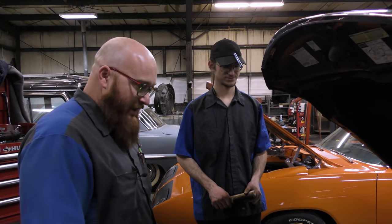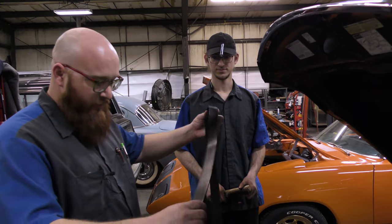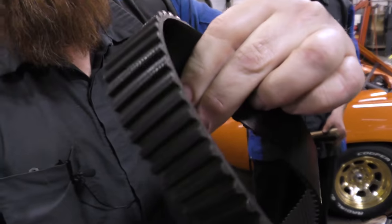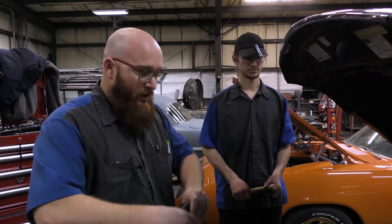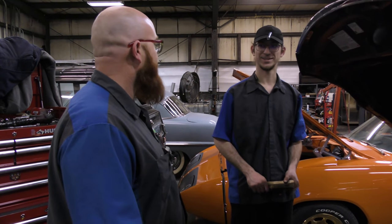So you've got this thing almost back together. Everything's looking good. The timing marks look perfect, but this is the original belt. I don't even see any markings on it, but it doesn't actually look bad. With only 60-some thousand miles, this is the original Lexus Toyota belt, and we're not going to take any chances. I'll let Long Beach get back to getting this thing back together — it needs to go to a lift next. That is the update on the SC430. The timing belt and water pump is almost done. We're about halfway done with this job.